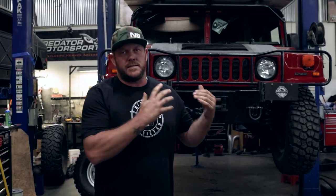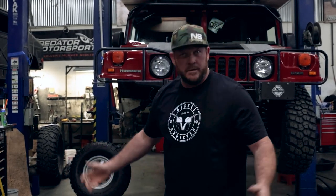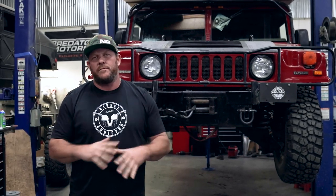Let's cut to that footage now. This truck is here for a post-purchase inspection — another variation of the PPI. The customer that purchased it is out of Washington; it was for sale out of here in San Diego. So it's in for what we call our 12K service. All fluids are going to be changed — radiator, engine, transmission, transfer case, diffs, and geared hubs drained. We'll also be inspecting the air filter, changing that out, fuel filter, and everything else. A 12K service is everything on this vehicle.